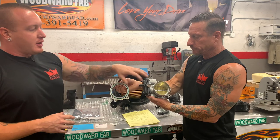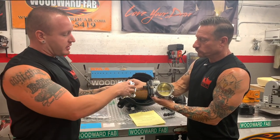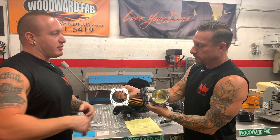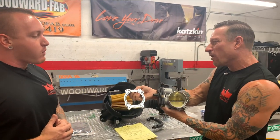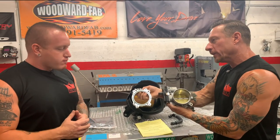This is actually the upgraded larger Ford Performance throttle body, as well as the adapter to go from the larger diameter inlet butterfly to the OE size of the factory plastic intake manifold, so that does allow that airflow to fit in there. This is kind of the replacement of a carburetor butterfly from an electronic fuel injection standpoint.